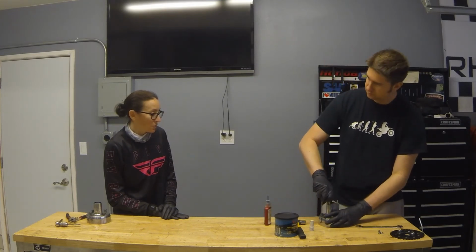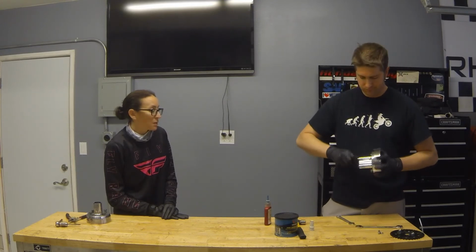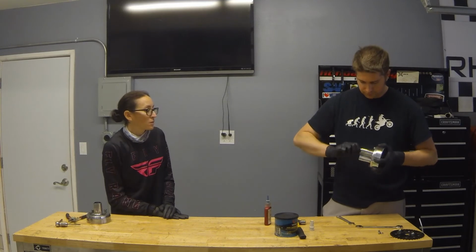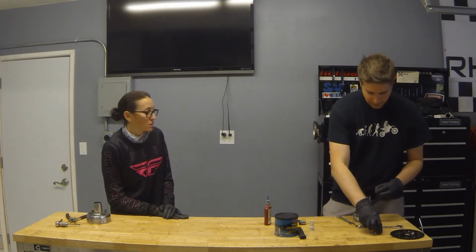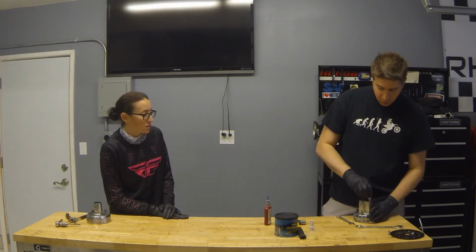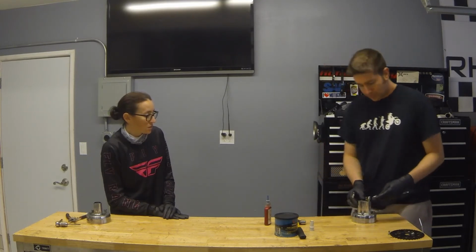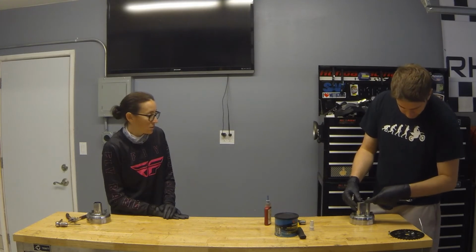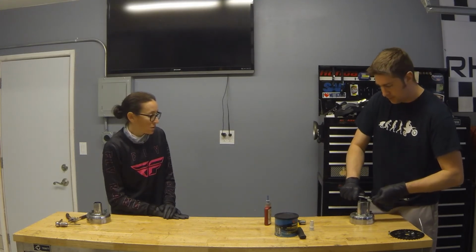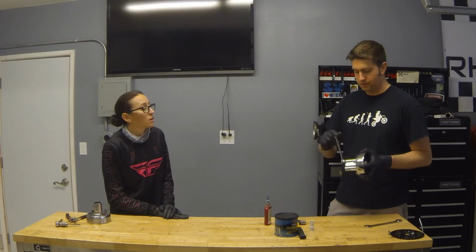Still can't believe it's really only that amount of thread locker. But it makes sense. I've seen it where people have literally coated the entire everything with the thread locker, and it is terrible to work with. It will be so much on threads all over everything. Trying to get it out is a nightmare, because at that point, you have to take a torch and heat it up to burn out all the thread locker.